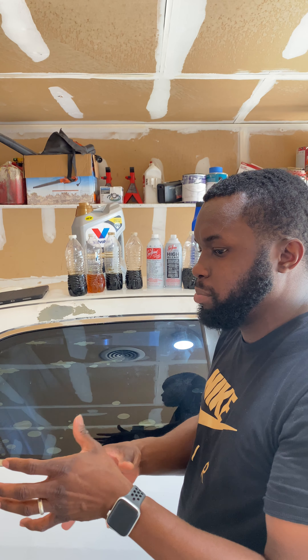This is four. The fourth one has about 52 miles on it. Just by eye, it looks just as black as the rest, but when you hold the flashlight up to it, it's almost as golden as the original — and that's ideally what you want. This is five: I did not put any Sea Foam in it, just straight oil. It looks about the same as three and four. Pretty good.